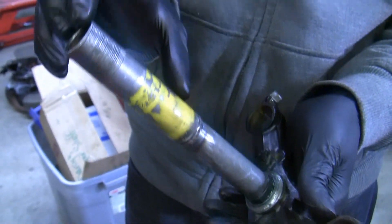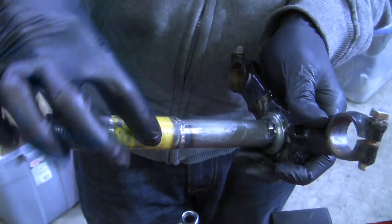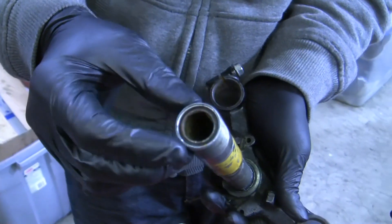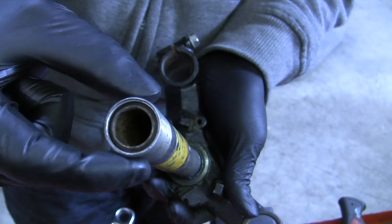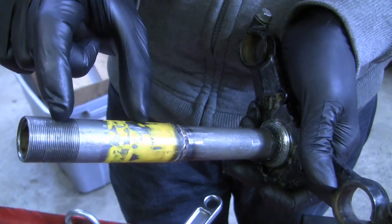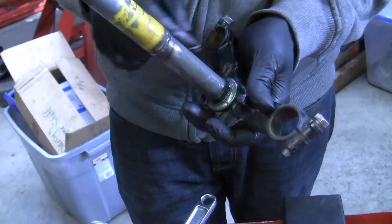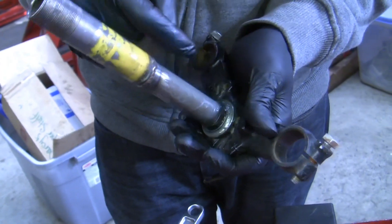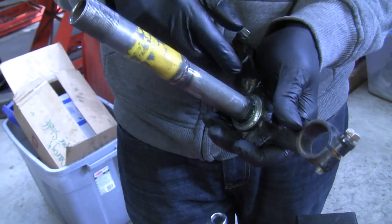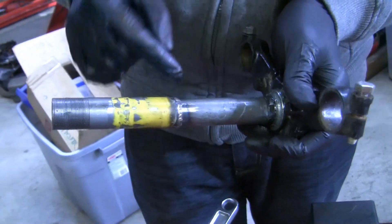Sliding the MB5 fork tube stem around the Hobbit fork tube stem was actually kind of difficult. I ended up putting it in a lathe and turning the inside of this piece down — making it thinner — so this stem here actually has three steps in it to get to the correct thickness. If you look at the top you can see the diameter of the original fork tube and the one we put around the outside. I had to machine the inside of the Hobbit one to be stepped exactly the same as the original fork stem, so it went around the outside and didn't rotate. The reason I didn't just cut the stem off and weld a new one on is that making sure the stem is square, true, and the correct length sounds like way more work — it could be crooked.